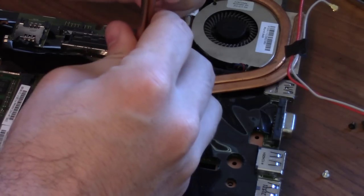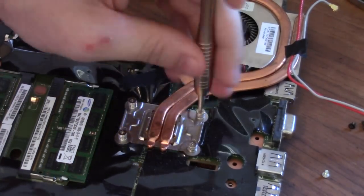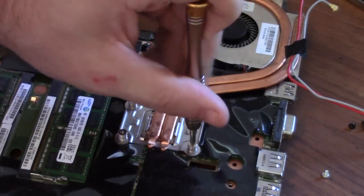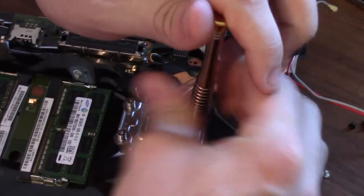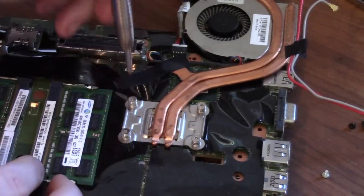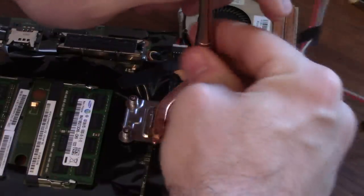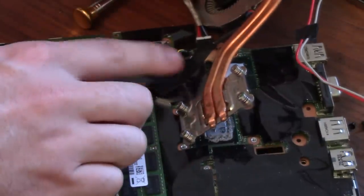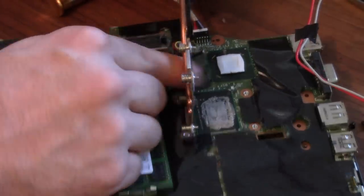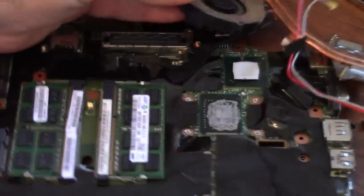To reveal the CPU, you'll see around it there are four screws. The proper technique is to unscrew them gradually — unscrew one a little, then another a little, then another. So I'm just going to unscrew them. These screws don't actually come all the way out. Notice there's some tape here — I'm going to very gently remove that tape. And there's a cord here too — I'm not going to yank that out.